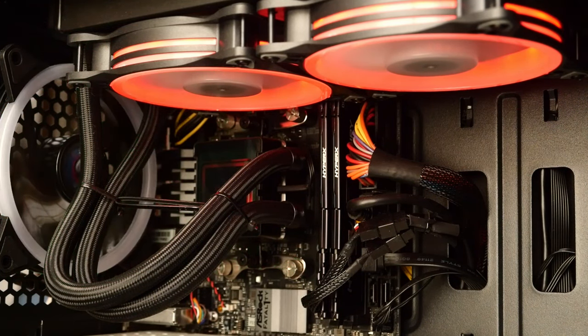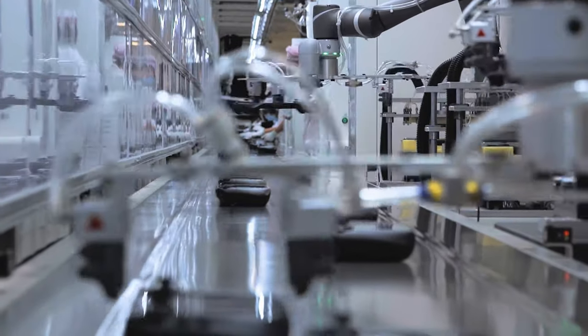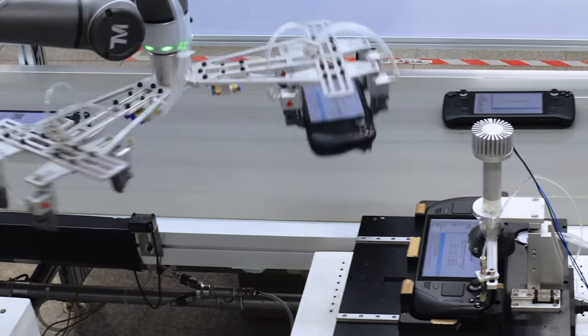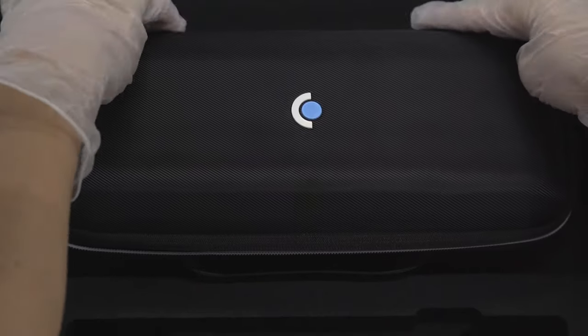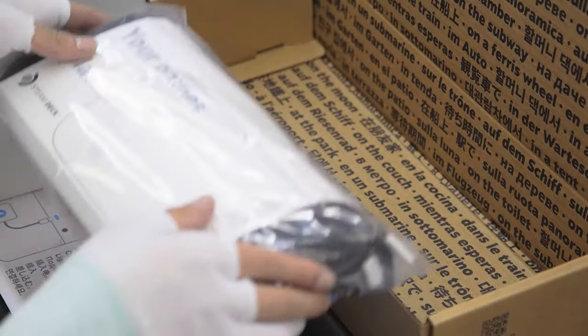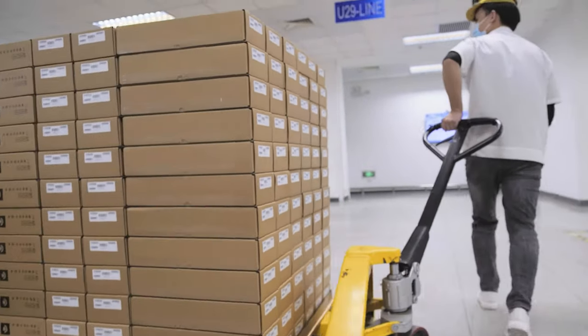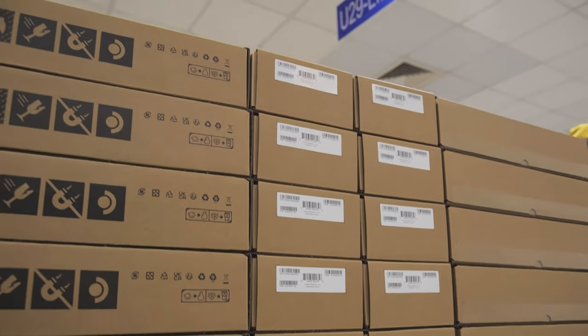The main con behind undervolting is that not everyone can do it effectively. Even though all Steam Decks have the same APU, not all Steam Deck APUs are made equally. All Steam Deck APUs are rated to run at a certain voltage rating. Anything below that is out of Valve's jurisdiction. You'll have to find out the limits for yourself. This is known as the Silicon Lottery, but everyone has access to undervolting tools. It's just a matter of how far you can take your Steam Deck.